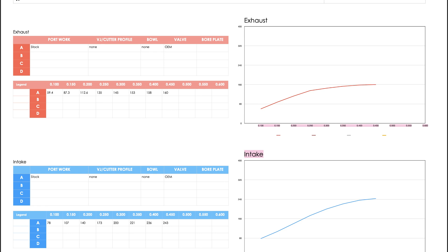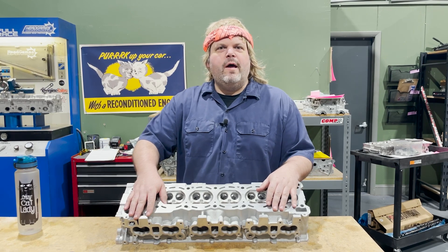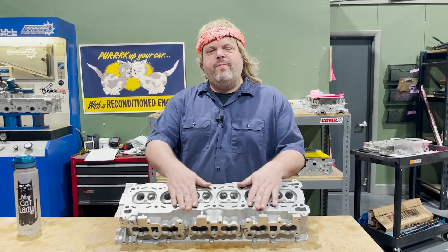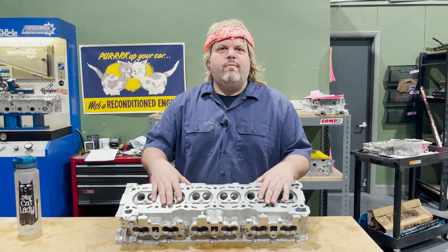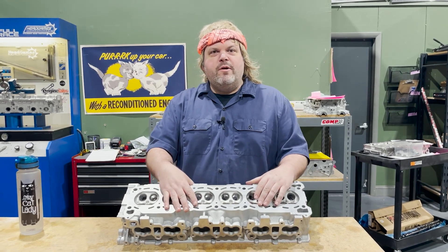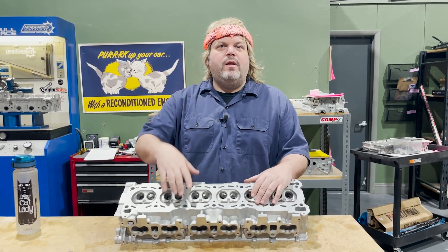On the intake side, she's not the best I've seen, but she's good at around 100 lift up to about 350 lift. But she ain't so good after that — it's kind of like, 'hi, I'm running out of air,' and you got this big-ass valve. Maybe it should have a bigger port. But it is what it is. Thanks for watching — we'll put some information in the description. Like, subscribe, comment below. Toodles!